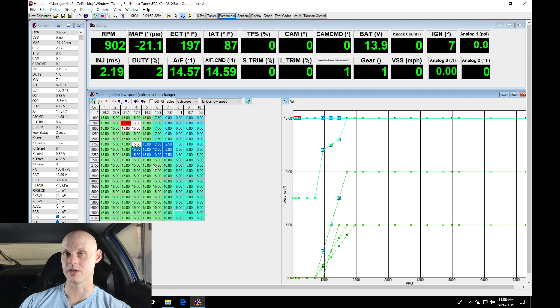I'm going to bring it down here to 2,000 RPM and I'm going to be holding my foot fixed on the throttle here on the dyno. I'm not going to be trying to look at my throttle variation. I want to make sure that I'm letting the same amount of air into the engine when I'm doing this process with the dyno for calibration.